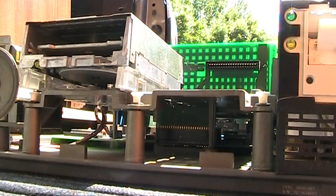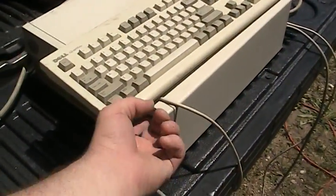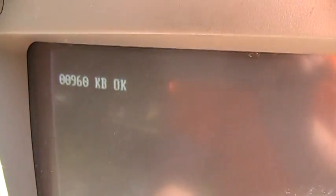It might have powered up before — I really couldn't hear it, it's not very loud. Now I'm willing to blithely assume that this IBM Personal System 2 color display is in working order. It does have high voltage, and when the signal cable was disconnected, it produced a raster as part of its built-in self-test. But a lot of these displays have begun to suffer from the ailments of time — bad capacitors and similar wear and tear. This one seems to be working. Hey, a memory count! Two megabytes — major performance system right here. I even heard the floppy drive seek. Given how famous those are for failing, that's got to be some kind of a miracle.